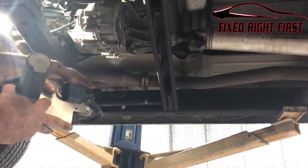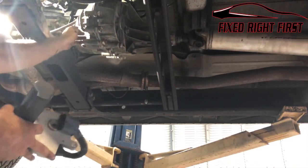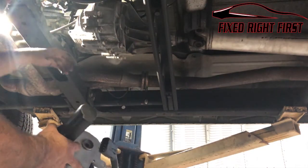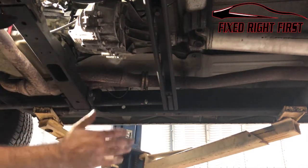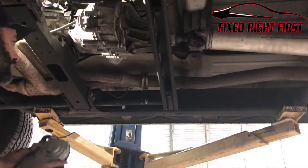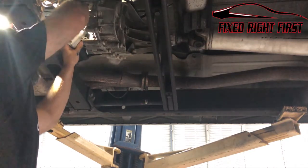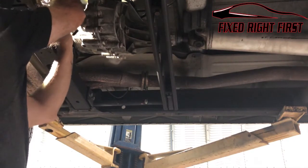What you're going to want to do is adjust the splines on the transfer case to meet with these. You want it to be in the neutral position. Just adjust the top here to meet the encoder motor splines — you can use a pair of pliers or vice grips, just be easy with it. If you want, you can disassemble the old encoder motor and use that gear as a reference. Just be gentle with it.